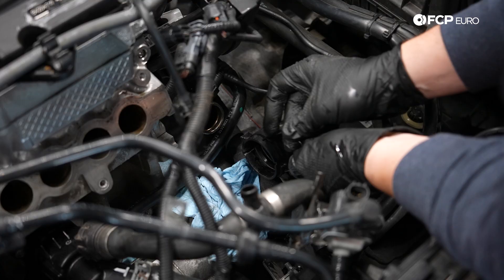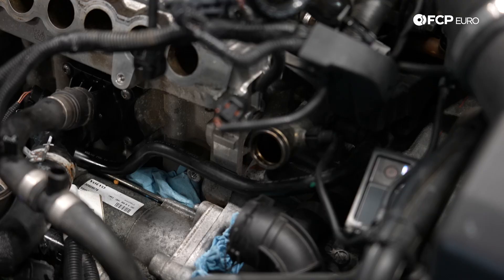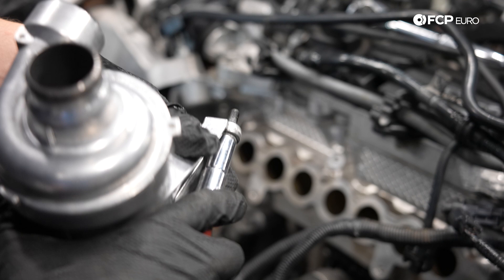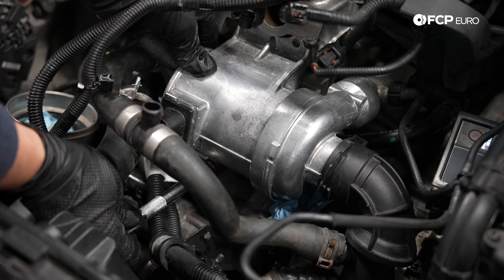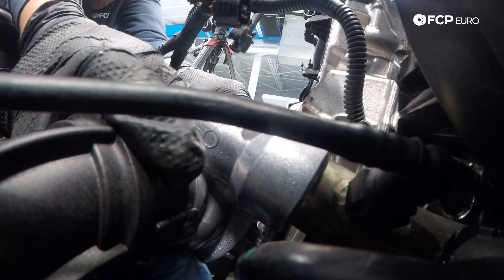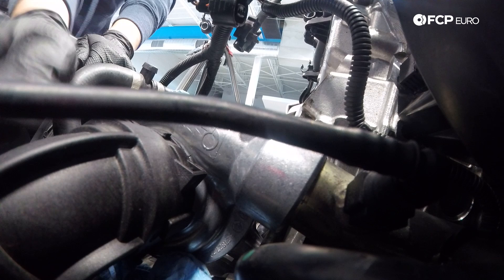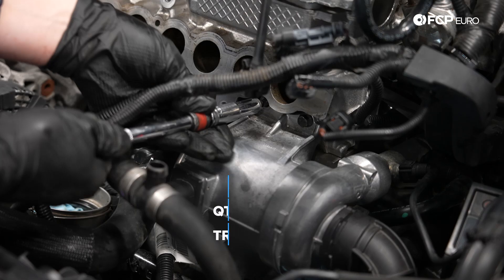Before I put the water pump in, I'm going to put this clip back in place so that it should just snap in — there's a detent here, it'll want to sit in once it's pulled out right there. I'm going to move this bolt sort of into the lower position so that it'll make it a little bit easier to thread once it's in there and also makes it a lot less likely to drop it. So what I'm aiming for is this hole right down at the bottom there. That's threaded on the bottom — good news. Before completely tightening it down, I'm going to put in the top bolts too. In the meantime, I can connect up the main hose. I did check the O-ring in there — definitely check the O-ring inside this plastic fitting before putting it back together, just in case you find something you don't like in there. This O-ring is seated nicely into the flange. Now I'm going to install the two top bolts finger tight. The torque spec for those three bolts is 24 Newton meters.